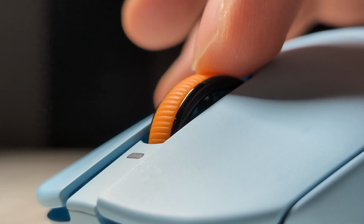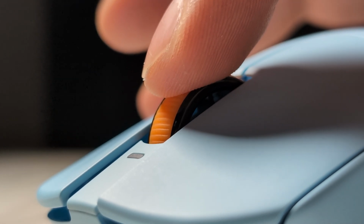Thankfully though, since the scroll wheel has such defined scroll points from the 11mm encoder, you can easily scroll wheel click without misactuating the scroll wheel, which is great to see. Overall, the S1O scroll wheel is solidly implemented. Personally speaking, I didn't mind the slightly higher actuation weight for the main click, as it's lighter than most scroll wheels out there. Maybe Santali could slightly lower the actuation force further on a future version of the S1O, but the current implementation is still very good in my opinion.